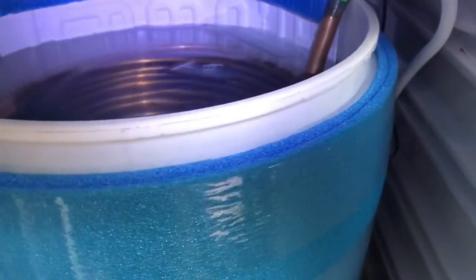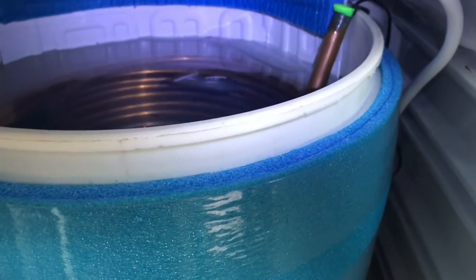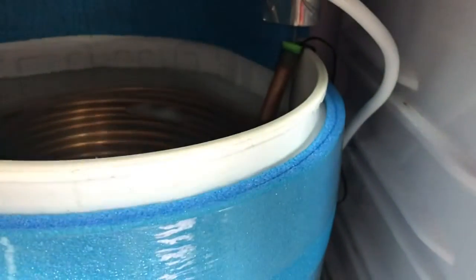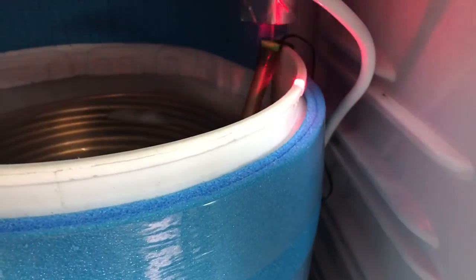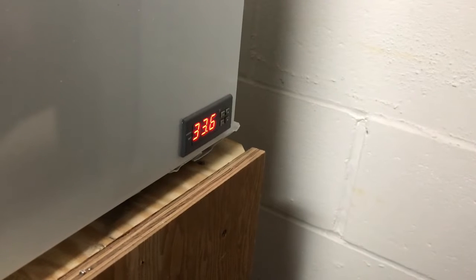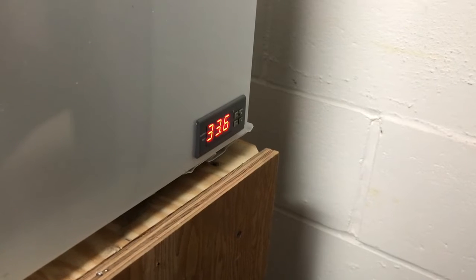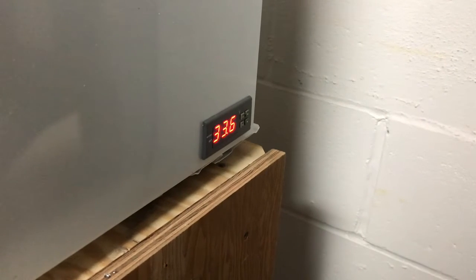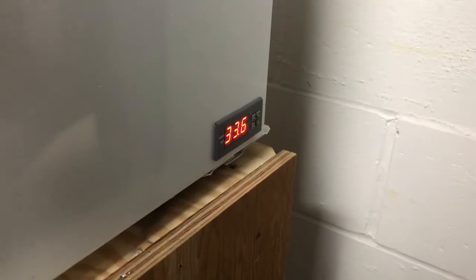This is extremely effective — I just opened this up for the first time in several months and it's very self-sufficient. There's a little bit of ice in there right now. I've also got a temperature wire lead that goes to a digital temperature controller bought on eBay, and that's what runs the refrigerator compressor. I think I've got it set to come on at 33°F and turn off at 34–35°F.